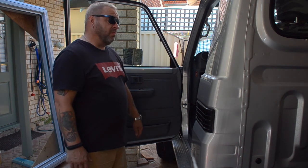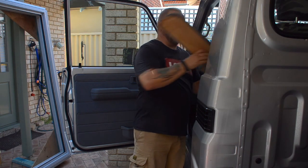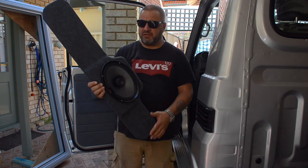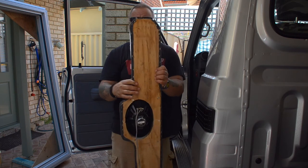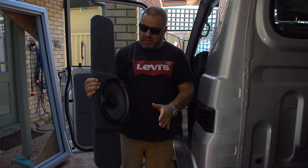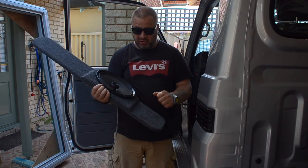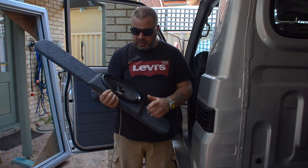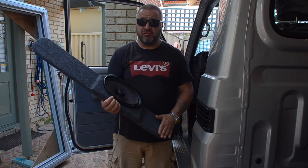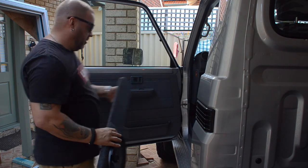In order to install speakers in the Land Cruiser I can't fit a better speaker in the original location, so I'm going to mount some new speakers in the doors. To do that I've had to make some speaker pods. This is the speaker pod I've made - it's made from marine grade plywood which has been fiberglass laminated and then carpeted. Being marine grade plywood it's going to be very durable, and with the fiberglass coating it'll be very tough.